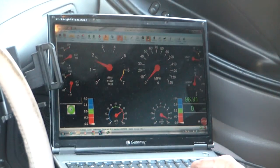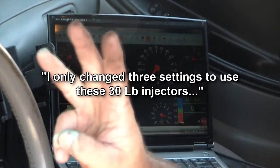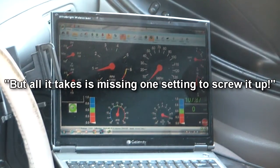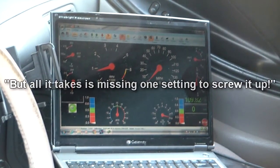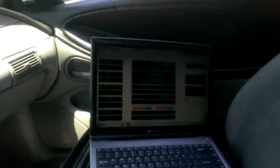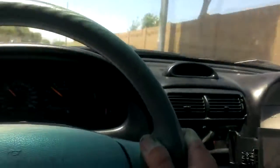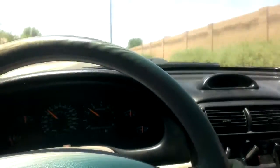Pretty much have to take a drive. I've only changed three settings to make those 30-pound injectors work, but I'm forgetting one setting. Even just going down the street so far, I'm not really watching anything yet, but it's driving like normal - not noticing anything weird. As a stick shift, I don't have a rider with me to hold any cameras. Spun out a little too much right there. And 12s for air-fuel when I've got wide open throttle - that is pretty good.